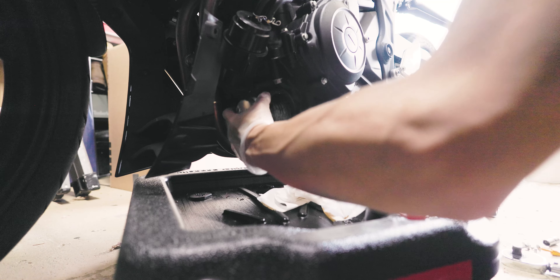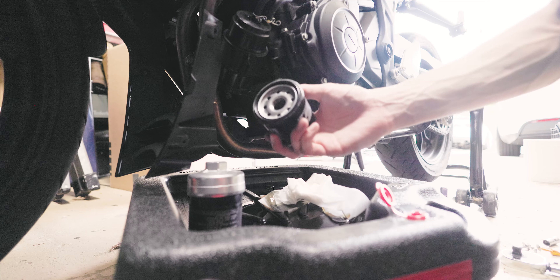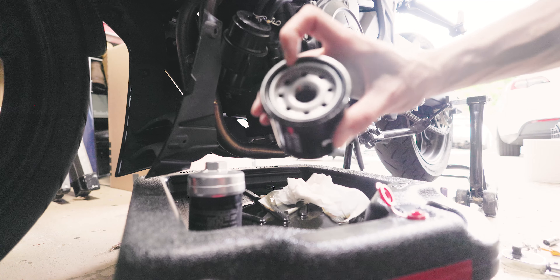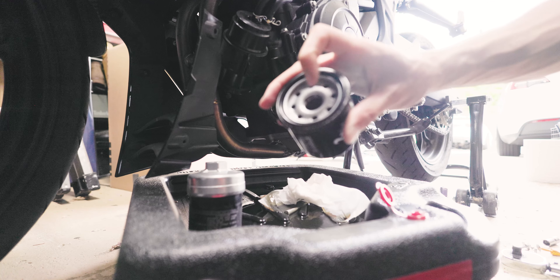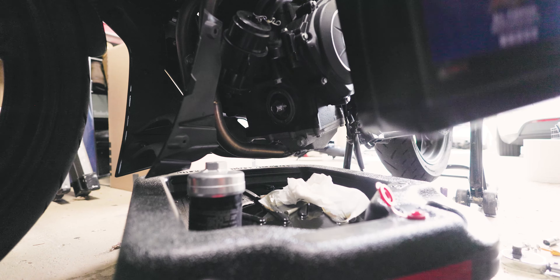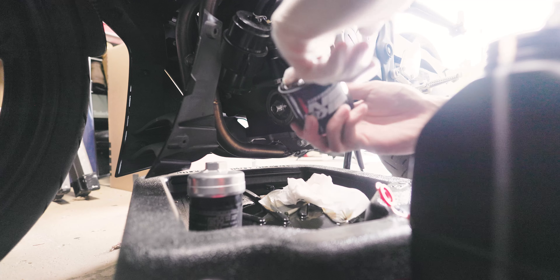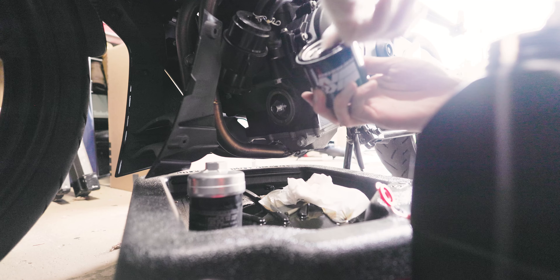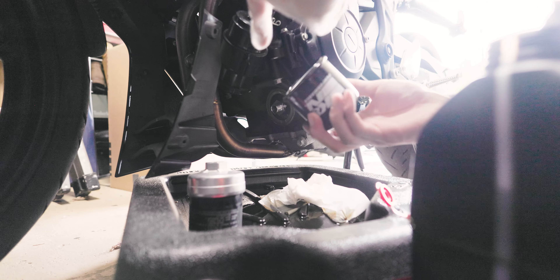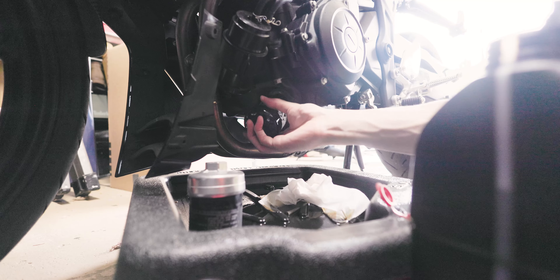Oil is already coming out — get rid of all that dirty oil. Here is the new one from K&N, their performance filter. I already removed the plastic and there's a rubber gasket on top. You actually want to get some new oil and just coat the O-ring area. Some people do fill it up inside as well, so I'm going to dip my finger in the new oil and just coat the new filter with it. I'm not going to fill it up — I've seen people do that but it's not really that big a deal if you don't. After you coat it with the new oil, you can take your new filter and twist it back on where the grooves are.